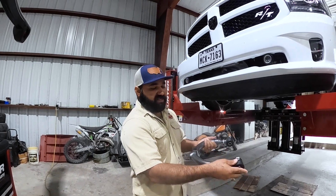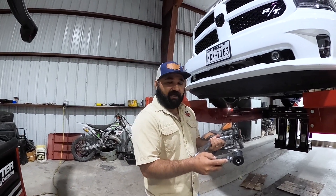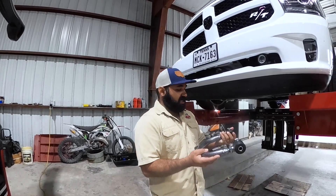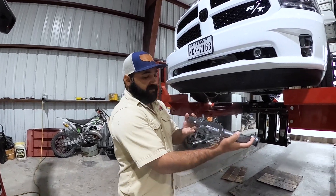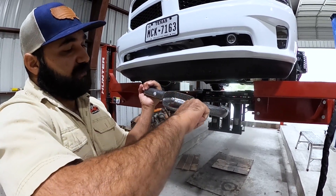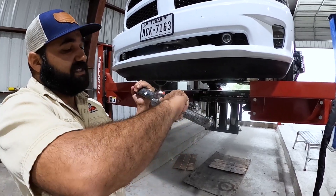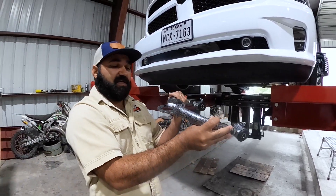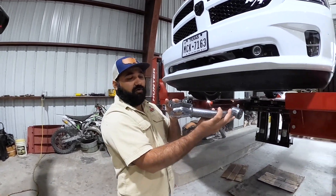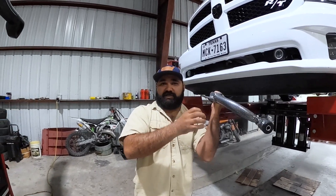Remember, zerk fittings go facing upward — we made it longer to compensate for the drop amount. On this upper control arm, you'll see we have more space on the upper ball joint plane than on the bottom. That's because it goes facing upwards. We incorporate the ball joint angle into the drop so that as the vehicle lowers, the ball joint angle is nice and straight so it pivots and articulates correctly on the spindle.